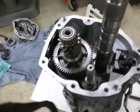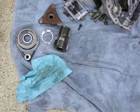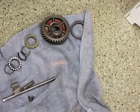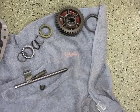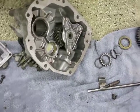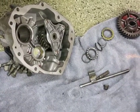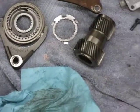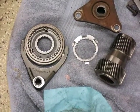In order, the next few things to install are the 5-6 gears, then the reverse shift fork, and then we have some parts of the reverse synchro, the reverse gear, and then the tail case. Before I put the tail case on I'm also going to change the seal. I still need to change the reverse synchros and dogs.